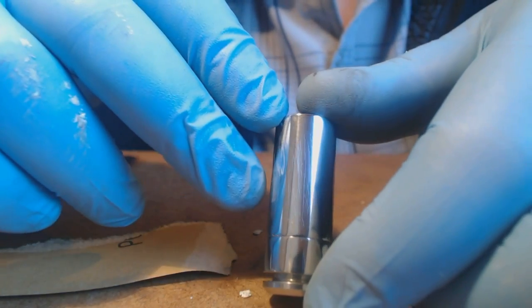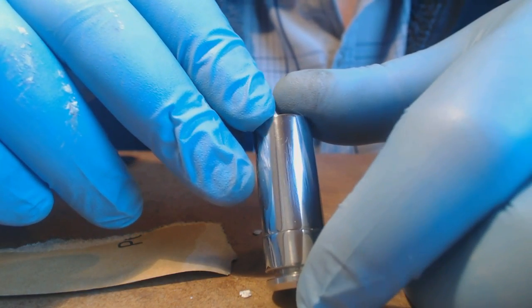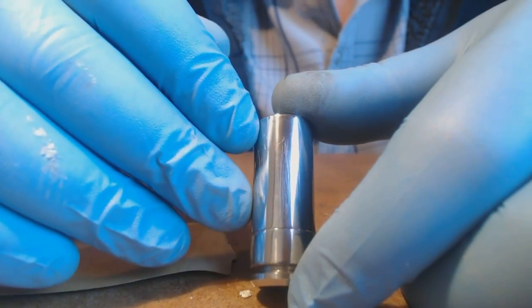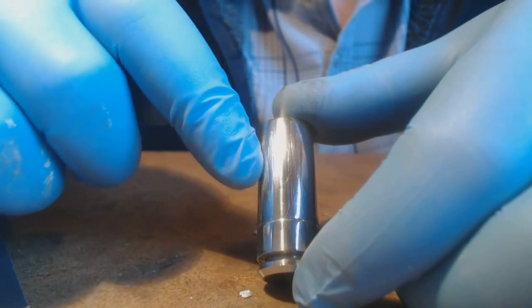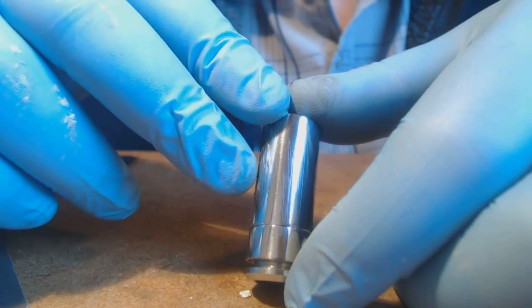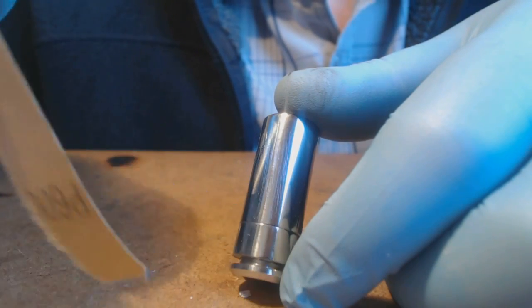And I would still suggest that you start with the least abrasive paper until you see how far you have to go down. You will learn over time that you can start off with, say, if I look at this, I think, well, I'm probably going to start off with P600 because I don't think the scratches are that deep, so I won't have to work at it that long and that hard. So I can just use something which isn't that abrasive, which is a bit of P600.